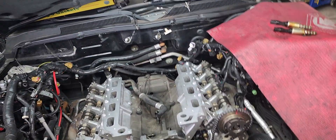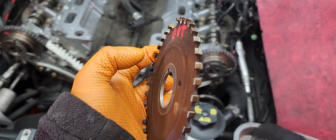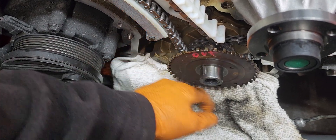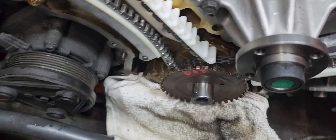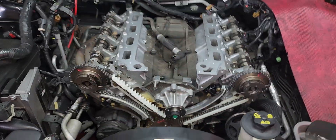This works for many applications — 5.4, 4.6, many Fords. Once you're done, don't forget to install this bad boy. See the grooves of the sprocket are facing out, the little nails are pointing out. I marked this one right when I removed it — put it in here. If you don't install this one, your car or truck is not gonna start, because this is the reluctance wheel for the crank sensor. Without this it won't send the signal and it won't start. So now we're good to install the timing cover, valve covers, and intake. Thanks for watching.